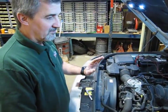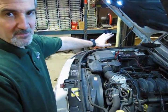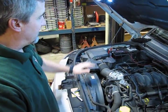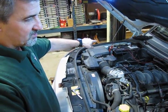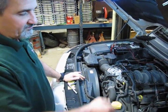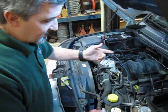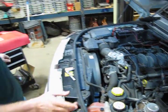All right, so at this point I have to turn the key on, ignition key is on, but we have the fuel pump relay out, so we're not going to load the cylinders up. We've bypassed the relay for the starter motor. And then we're going to assume we've gotten a misfire code for cylinder number 2, which is the front cylinder driver's side. So the first thing we're going to do, and I'll explain about that screwdriver.